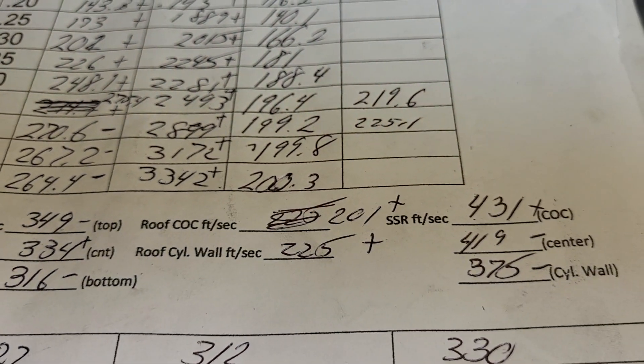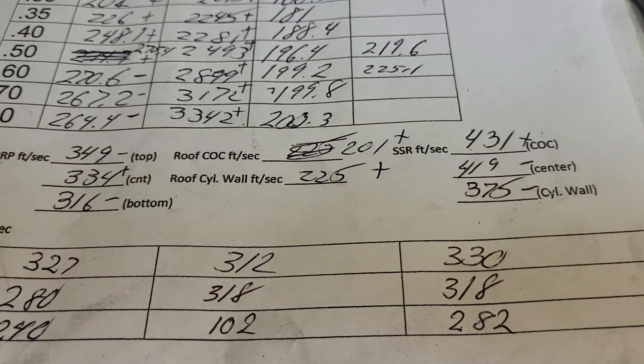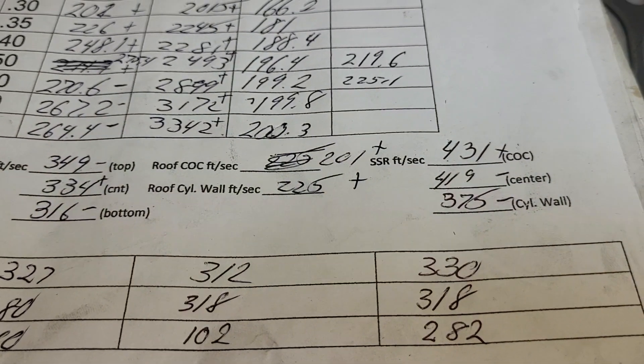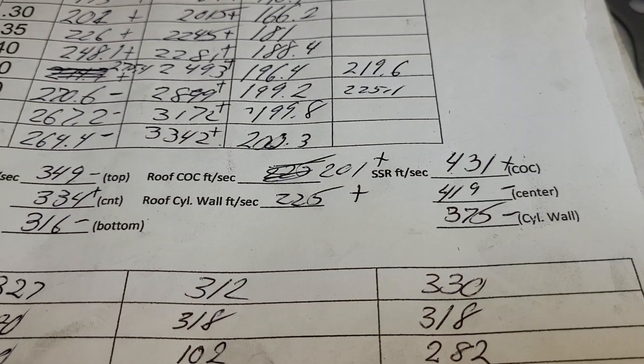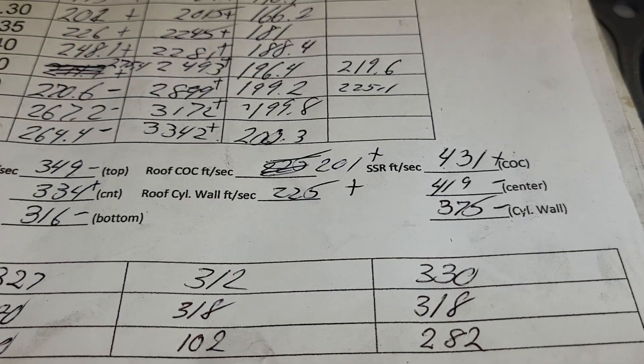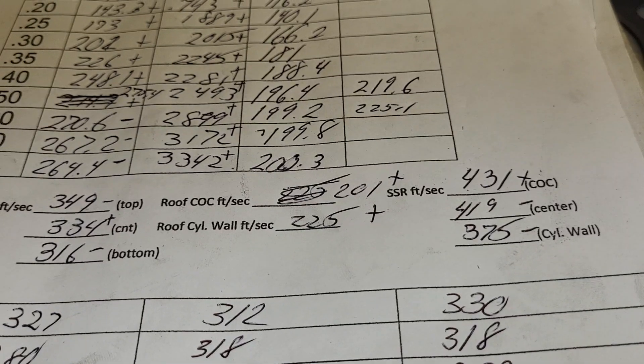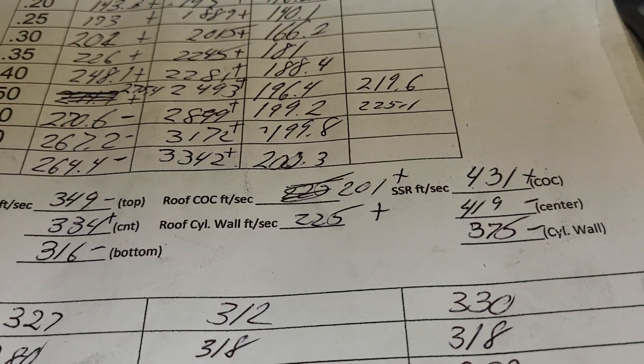The short side was not blown out for the 194, so it's definitely narrow for a 202, and I did not knock the apex down. Remember it's completely stock - it's got a really nice shape so you don't want to ruin that.